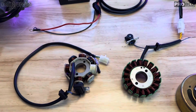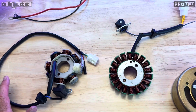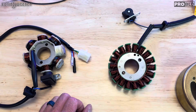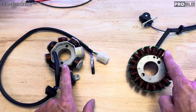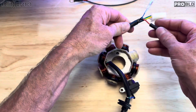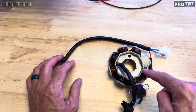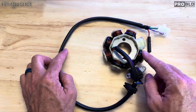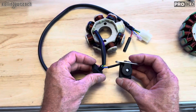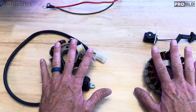Now let's talk about AC versus DC ignition systems. You can't talk about an ignition system without first understanding the charging system because they're a little bit integrated. If you have the exciter coil, you have an AC stator. If you don't have the exciter coil, you have a DC stator. Both of them charge AC — they both go back to the rectifier regulator. The deciding factor is: do you have an exciter coil, or do you have this extra wire?